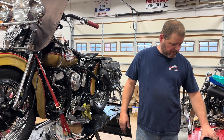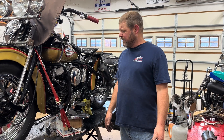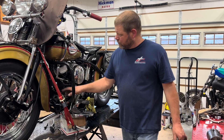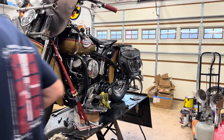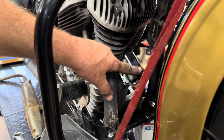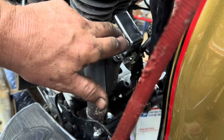You can convert these motorcycles over to 12-volt fairly easily. You have to change the relay, and I want to show you over here where that's at. This right here is the regulator, but it's in the same place and looks just like the relay for a six-volt system.